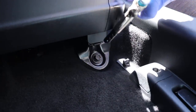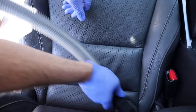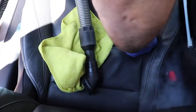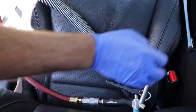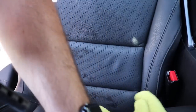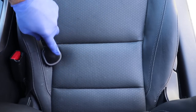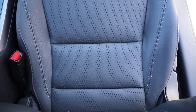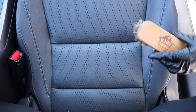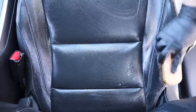The leather was also in great shape, but we make sure to vacuum the stitched seams very well and release that trapped dirt that will grind away at those stitches over time. A little steam also loosens those dirt particles so we can purge the seams with the air compressor and vacuum. We love using Meguiar's dedicated leather cleaner so it doesn't dry out the leather or plastics. We use a boar hair brush to clean and agitate the leather. Using a little steam also boosts the cleaning power of any cleaner.